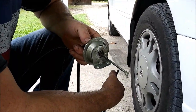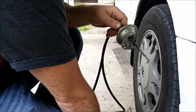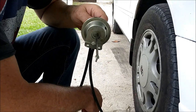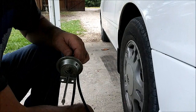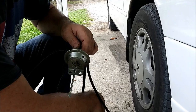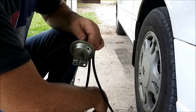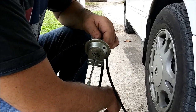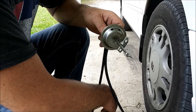This is the ACIS system — it's an acoustic induction system. It's similar to like a ram air type deal, where it lets more air into the intake at a certain RPM range when you're giving throttle or need instant throttle response. It's responsible for helping you get smoother acceleration, distributing horsepower in the mid-range and low end, and probably fuel economy as well.